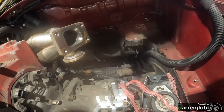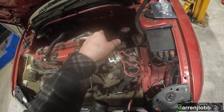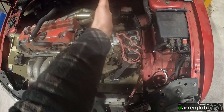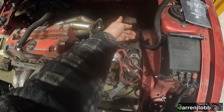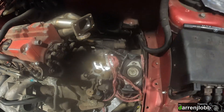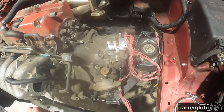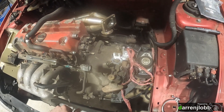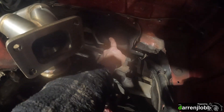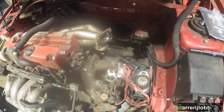I want to go through somewhere that's hopefully out of sight inside, but we've got to be a little bit careful because the cables are a set length. If I go the most direct route they're going to be too long, and they're not particularly flexible so we won't have anywhere to get rid of the slack. I think what I'm going to do is come through around about there, which will put them at an arc as they go in. According to my measurements that should hopefully end up with the cables reaching and fitting quite nicely without any ridiculous bends inside or outside. I've measured 20 centimetres across inside and there's a nice flat area on the 306 chassis there, so we're going to get a hole saw and bang a couple of holes through.